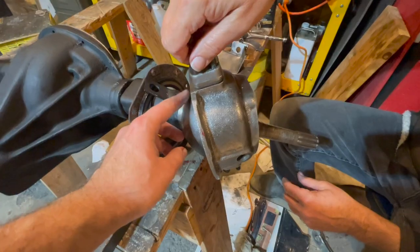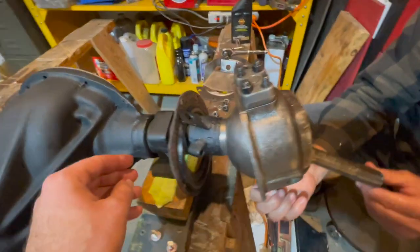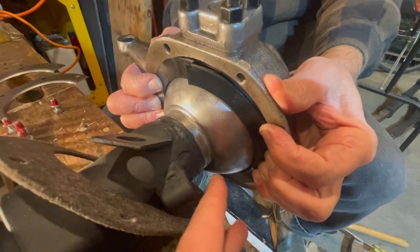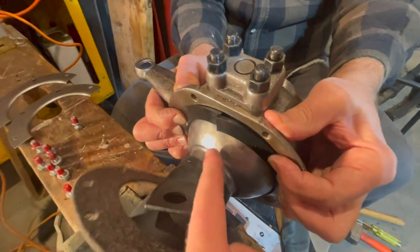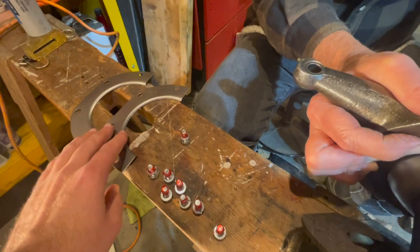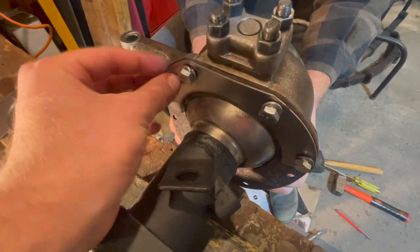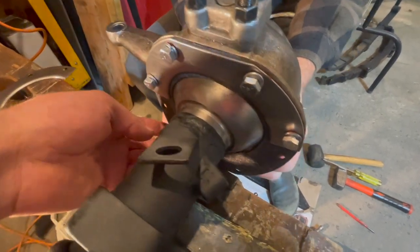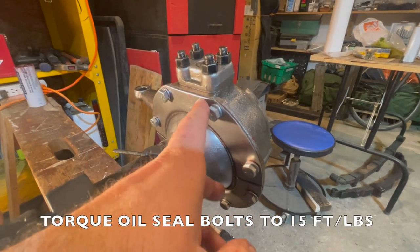Fast forward to the lock washer stage — hand tighten the nuts on the top and bottom of the king pin just to hold the knuckle in place. Now install the seal on the back of the knuckle: push the rubber seal starting from the bottom and work up, with the joint at the very top so oil won't leak out by gravity. Apply gasket sealer to the bolts, thread them right through the plate, through the felt, and into the knuckle — top four bolts horizontal, then the bottom plate. Snug up all bolts, then torque the back seal plate to 15 foot pounds.